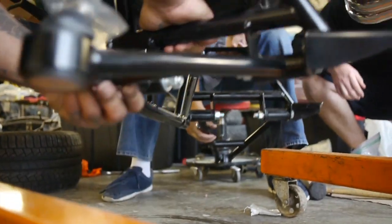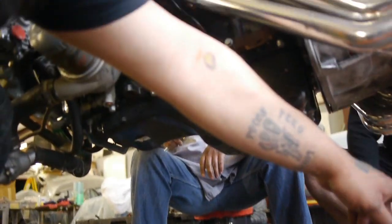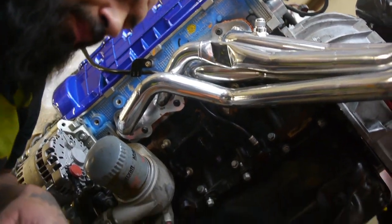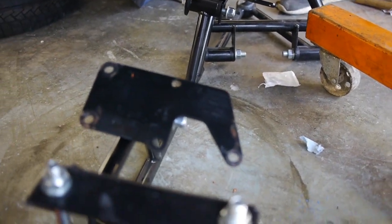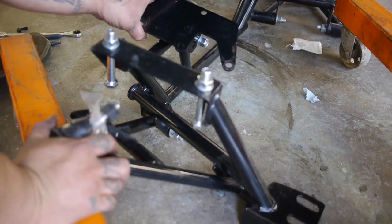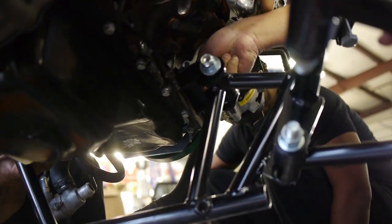In order for me to do that, you have to take off the motor mount. Yeah. What size? It's a 13 millimeter. You might have to break them loose first, maybe. Is there four of them? Three. Hey, Mike, which one was it? No, that's a 13. Right here, these two are the same length. Cool, thank you. So this one goes here? Yep. You gotta watch the starter. Yeah, there you go.